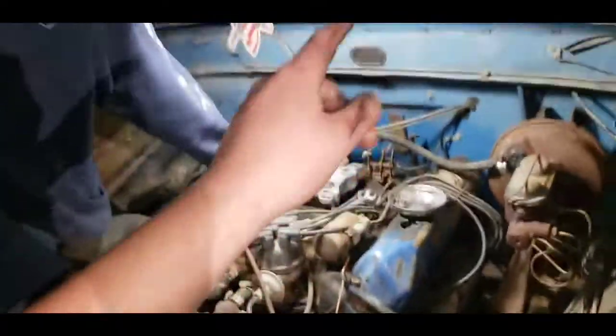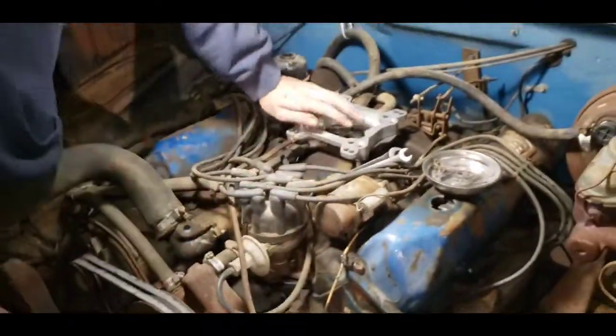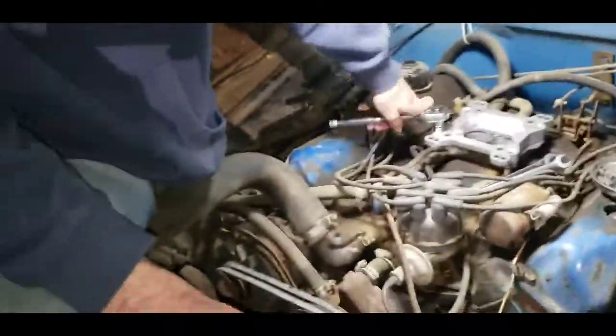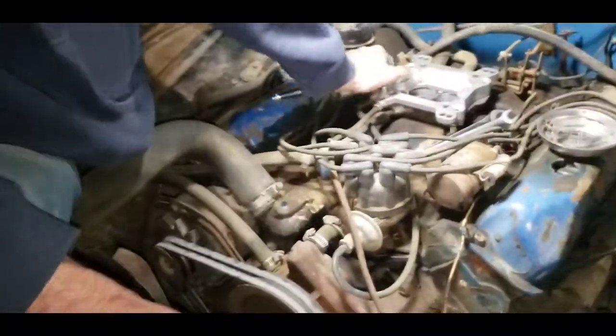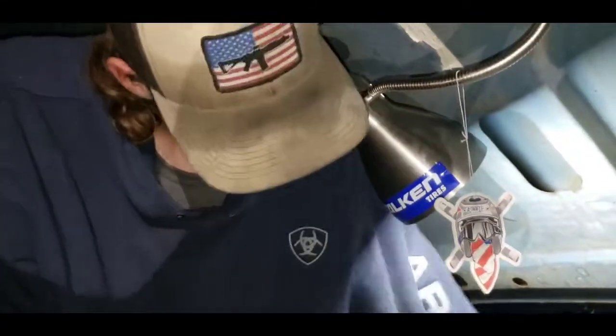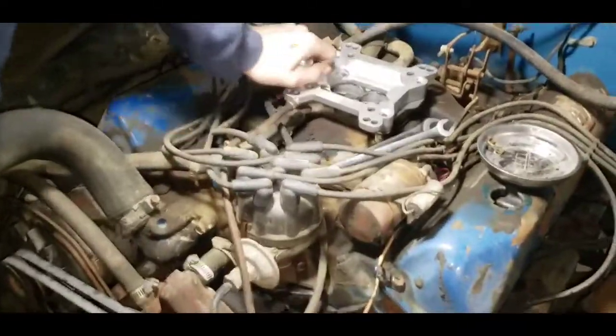Oh yeah, so we started it and it was shooting. We pulled the carb head off and it was shooting fuel from here about 6 or 8 inches up in the air and pooling it down in the valley. So that was not good. We realized we needed a new carburetor at that point, because it's shooting fuel out of somewhere that shouldn't even have fuel shooting out of it. Yeah, well, the float was stuck open, so it's constantly just dumping fuel and overflowing. So that's always a good thing. That's what was happening there.